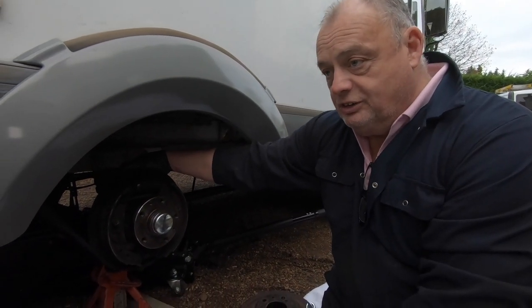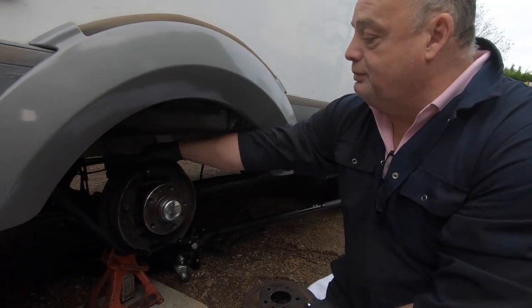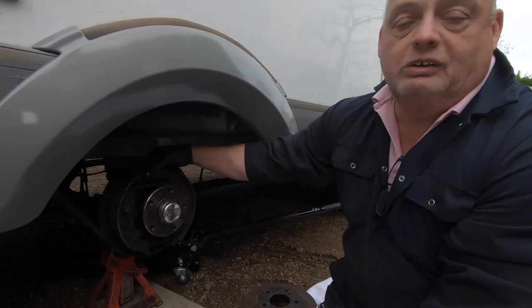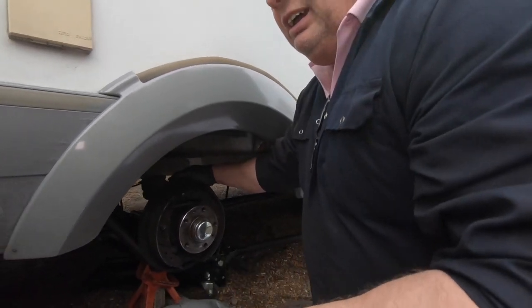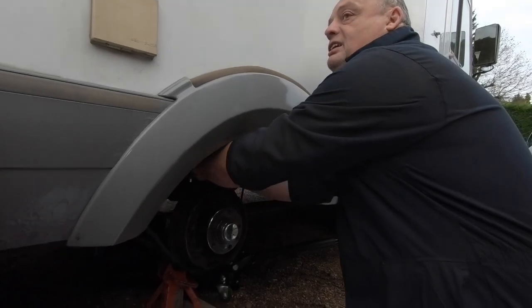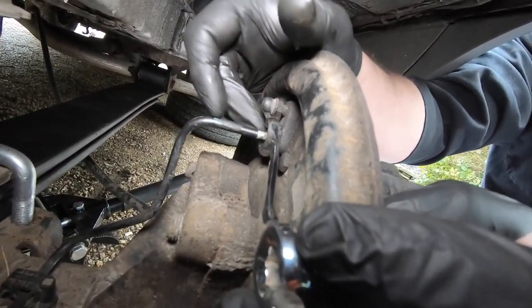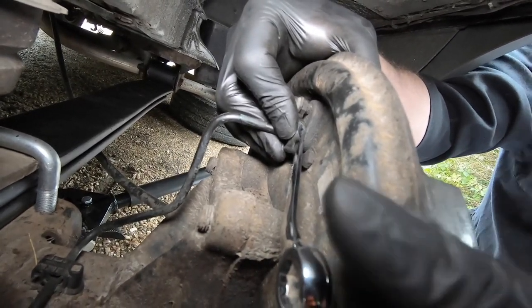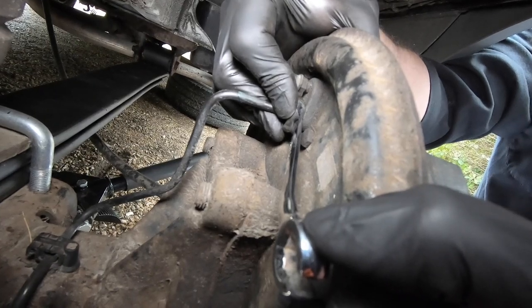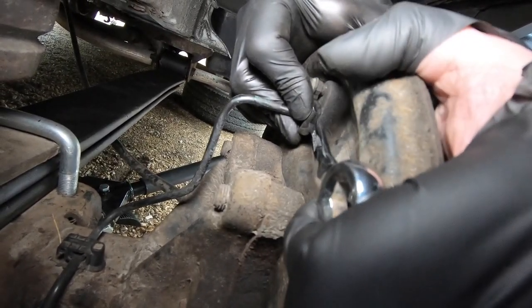Soak them first. Do this before you change anything else, before you even attempt to get into the shoes, because if you start getting into the shoes, then you can't get the wheel cylinders off. So take your spanner the right size, over the pipe and grip the nut. You can see it grips four or five sides of the nut. Then just gently, with your thumb, no more pressure, try and push it down a bit first to tighten it, and then up with your fingers, gently.